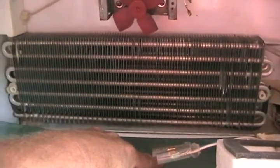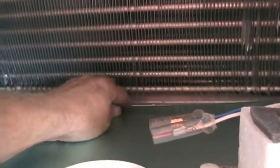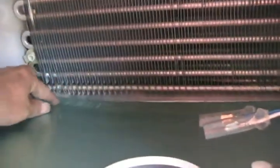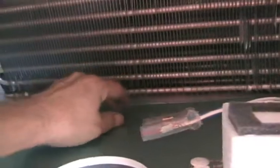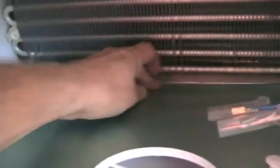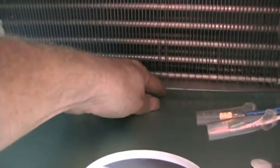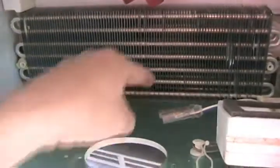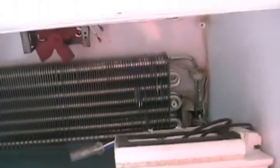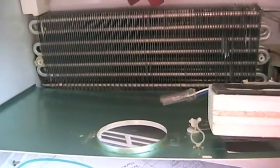Another reason the fridge may seem to have a defrosting problem is the catch basin that catches the ice dripping off all the cooling elements. It gets clogged — sometimes just with a pea or a piece of corn — and it just keeps building up a layer of clear ice at the bottom. In a normal defrosting problem the ice is always snowy and crunchy white, but if you see a whole layer of clear ice, that's a drain clog problem. Some fridges actually have a heater in that catch basin, and if that heater is broken, every time water drips off it refreezes and just keeps building up ice. You have to defrost it again, clean out that little trough and hole, and test for resistance — it should be between 50 and 100 ohms.